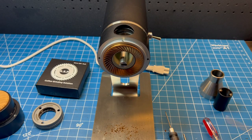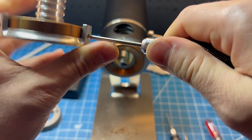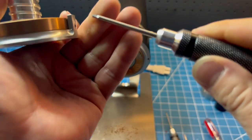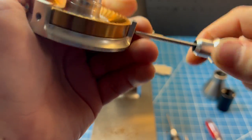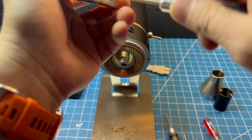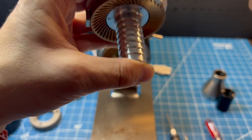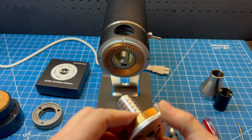I'm going to triple check our work and then tighten the radial screws — it's very important. Always remember to tighten the radial screws. Get them snug first and then give them a full tighten. Don't over-tighten them because you might actually bend the wipers — snug, not extremely tight, is the key here.